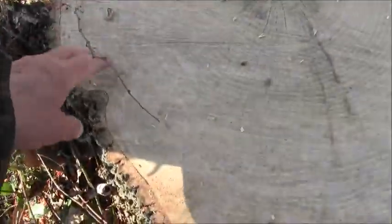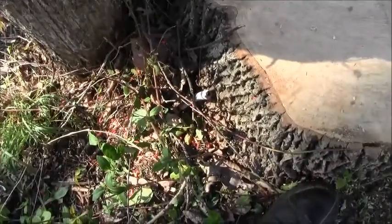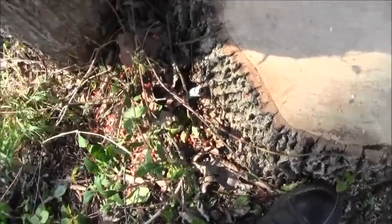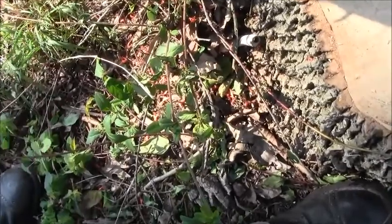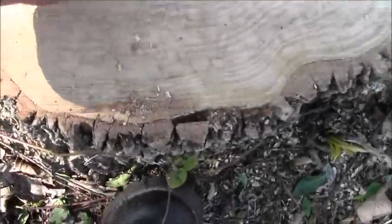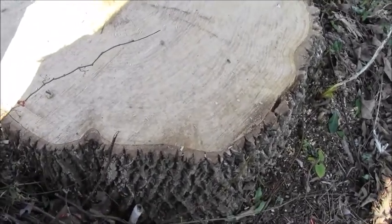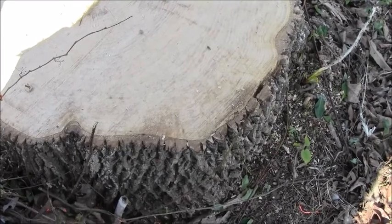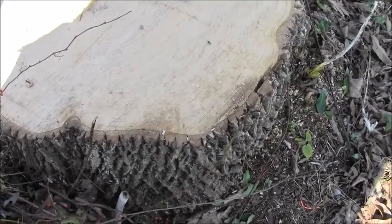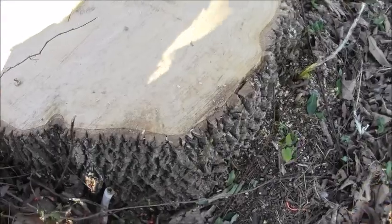The other day when we were cutting this down, I put my wedge in to steady it and a cedar tree was in the way, so I didn't have enough room. When I ran the saw through, it tagged that cedar and you can see the orange chips where I hit it. That dulled one side of the chain just a little bit, and you can see where it curves off. I noticed immediately that the saw was curving — just touching that plastic wedge dulled one side of the chain. I had just a few inches to go to get out so I finished the cut.